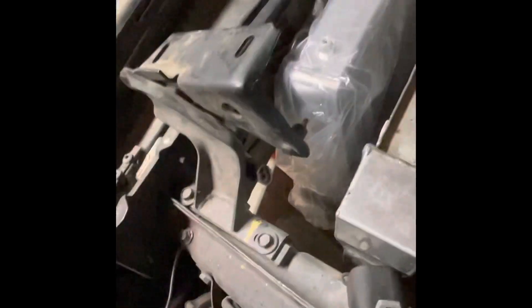I'm going to try and fit this intercooler here with some mounts. I'll run mounts from probably these holes to maybe the hood hinge bolt holes on each side for support. The outlet on this turbo should come in and worm in here once I modify this little pan. It should come in through here and wrap around to the other side, which means I'm gonna have to relocate my horns that are right here.